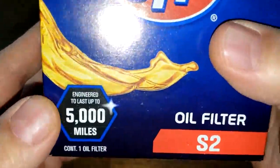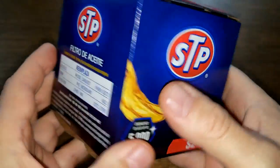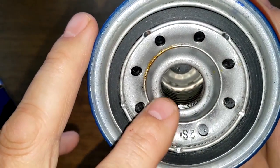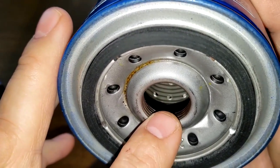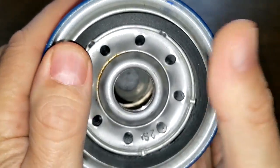Let's start with the STP. This filter is rated for 5,000 miles. On the box you can see filters it replaces, country of origin, and that's about all the important information. Opening it up, we got a date code: 1-1-2-8-2-2-2-8-1, made in USA. The STP has eight inlet holes — kind of small — a nitrile rubber drain back valve, about four grooves for threads, a metal core with holes, a bypass valve down below, and a nitrile rubber gasket which looks on the thin side and comes off easy.